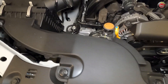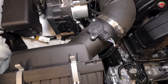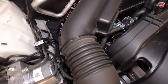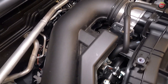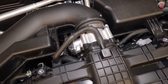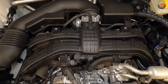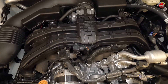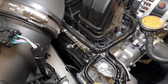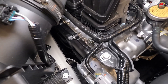Following the airflow, the engine breathes through a snorkel located at the top of the front radiator support. Air flows back into the air filter box located at the front passenger side of the engine compartment, then rearward to a single-bore throttle body. The composite plastic intake manifold divides the airflow to either side of the flat four-cylinder engine's two-cylinder bays. The engine features full aluminum construction of block and heads, and two cams on each head feature variable timing. Exhaust exits the heads at the bottom of the engine on both sides and immediately into the catalyst system, which largely cannot be seen from the engine compartment.